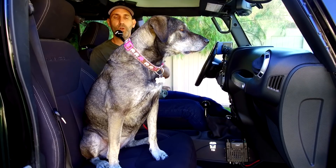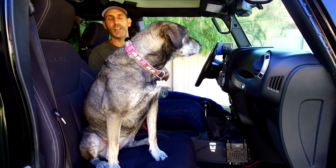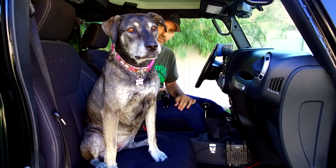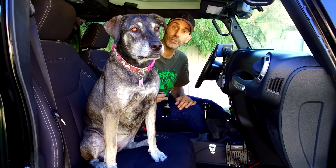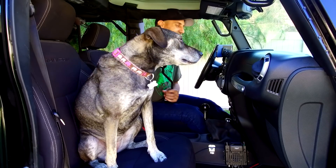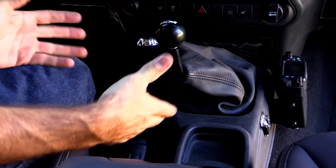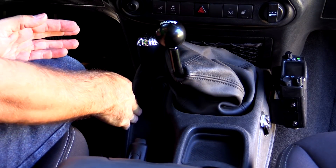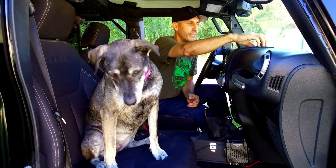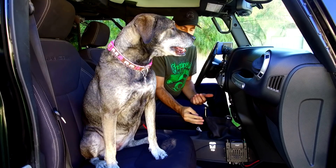One of the reasons I think this install is so great is that it just really personalizes the inside of your Jeep. To get started, all we need to do is pull the center console out and get at the bottom of the actual shifter we're going to replace. That entails pulling off the stock shifter knobs — I'll set that one there — now that's because I have the B&M precision shifter here.